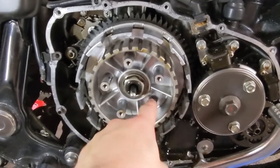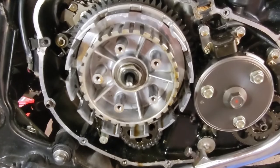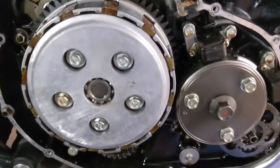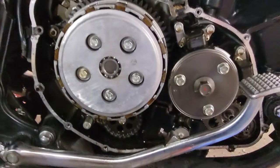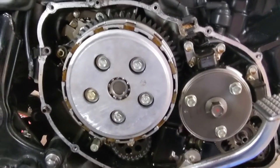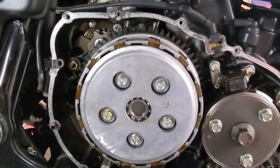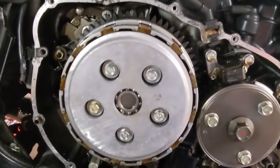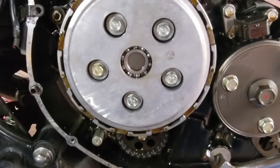This might become a bigger project than I ever wanted it to be, but for today we're gonna do what we do best — we're gonna send it and get this back together. The clutch is back in and torqued. Quick tip: I got a lot of warnings about these bolts breaking easily, so go with the snug method. My advice is amateur's advice, but I bumped them up a few inch-pounds at a time and got them to about six foot-pounds, which is about the lower limit of the spec. I'm not throwing Loctite on them because I think I'll be in here again soon.